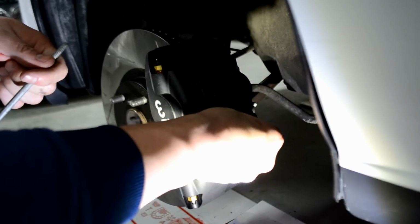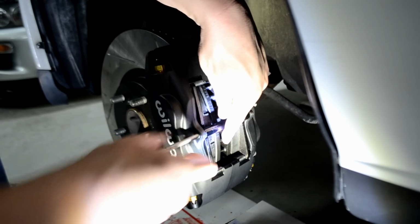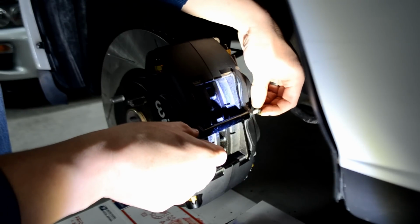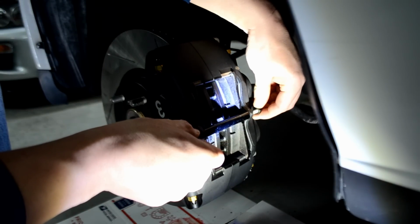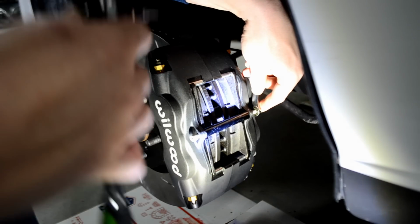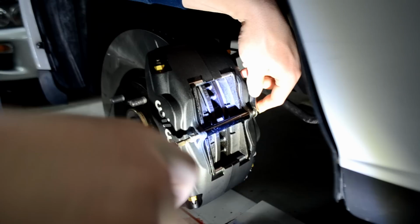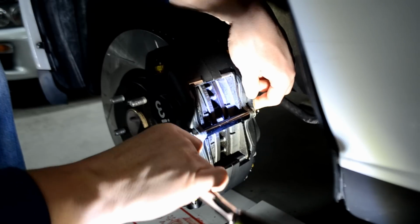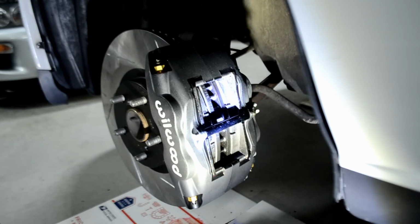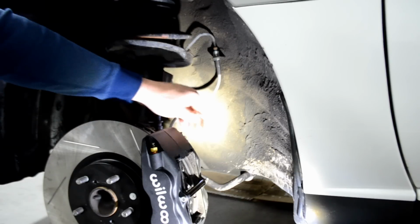So let's go ahead and lay the metal bracket in like so. We'll feed the bolt through. This way, all you see is the nice, pretty Allen head on this side, and then the ugly stud end and the actual nut are on the other. Now, what we're going to have to do is use our 11 millimeter on the nut head and our 3/16 hex key on the hex head. And we're just going to go ahead and spin that on here real quick. And there you go, guys. That's 100% on.